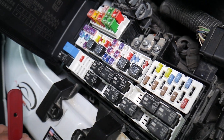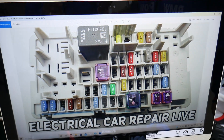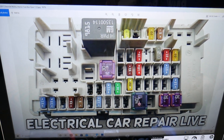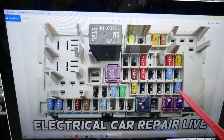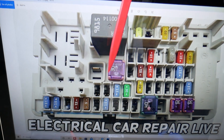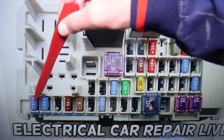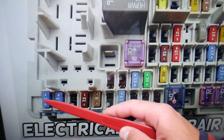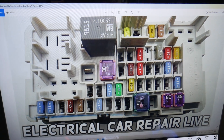So what we have here: we need to check one, maybe two fuses. Never assume anything about fuse numbers — the numbering in this box goes one through nineteen on one side, then continues on the other side starting at fuse 38, 39, 40, 41, 42. The fuse you need to check for the radio is right there in that area. Check it — if it's good, pull it out, let it sit for a minute, put it back, and see if that fixes the problem.